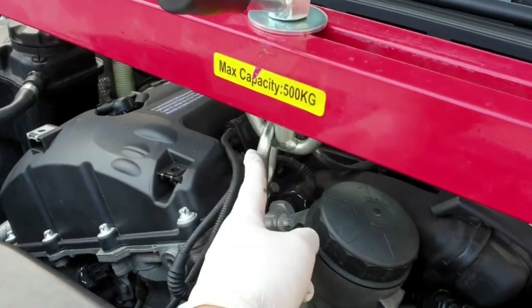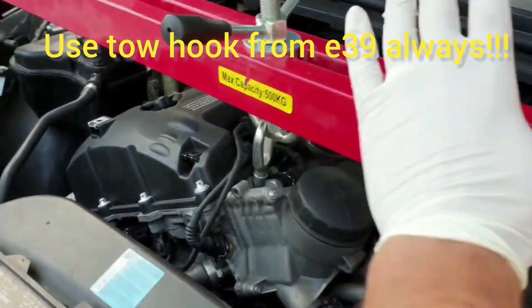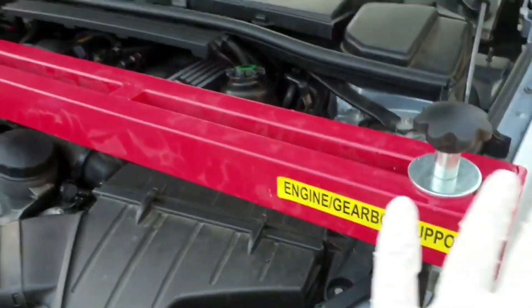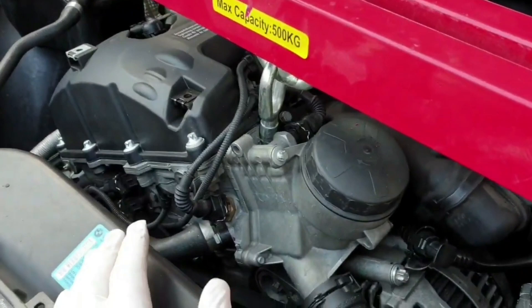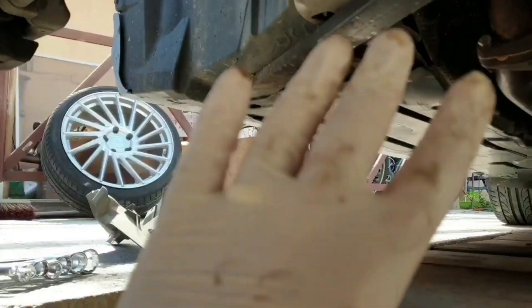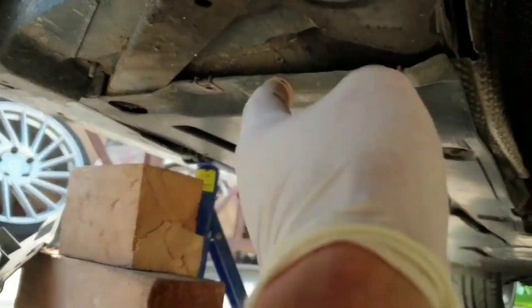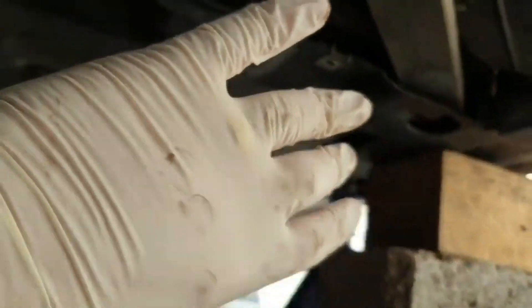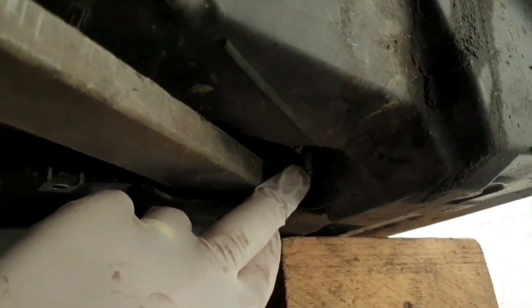Now that I have the tow hook from the E39, I can lift the engine — everything is tight. I have to go underneath to start removing some parts. We have to remove this plastic cover. Everything was 8mm in here and just a 10mm nut, the same on this side — everything with 8mm tight and a 10mm in here.